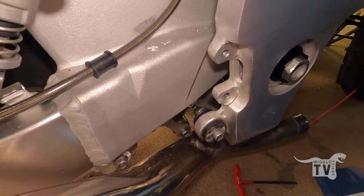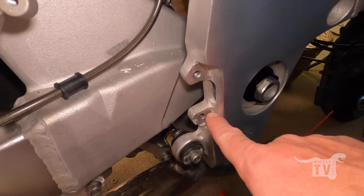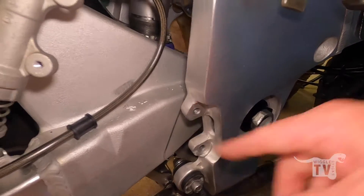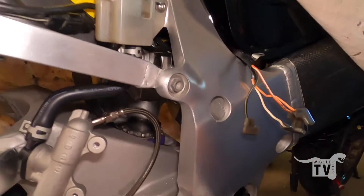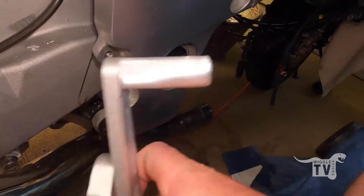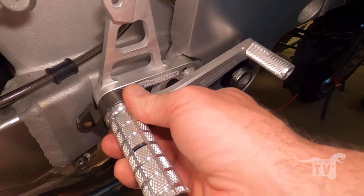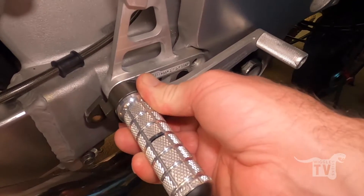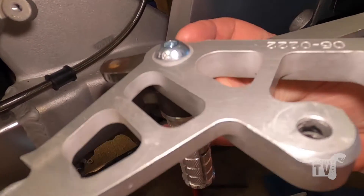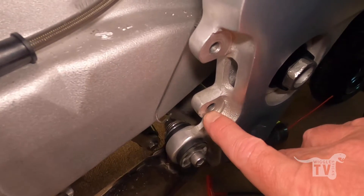After a little bit more investigation, I think the issue is the grooving inside the casting in the swing arm. It's got this little ridge here and the base of the footrest is just not sitting flush — it's resting in the corner rather than sitting flush where it needs to be. I'm going to take a little bit off the corners there; these ones already have some off, but I think just a little bit more, and it should fit flush and stop knocking on this little gap in the frame.